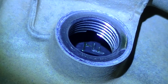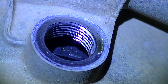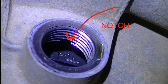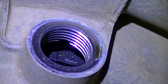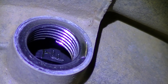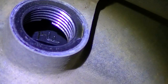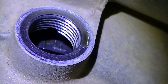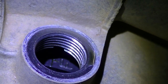So once again, now that I've adjusted the rear cylinder, I've rotated the engine forward. Watch the intake valves go up and down. And now I'm looking for this other mark here, which is TF, which is top dead center front cylinder. And you want to make sure you watch those valves so that you're for sure on the compression stroke, because you don't want to be adjusting valves if you're not on the compression stroke — that wouldn't be good, it's just not going to run right. Your valves should have some play. My exhaust valves and intake have play.